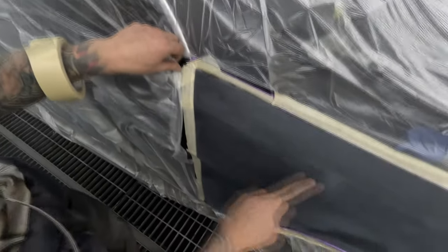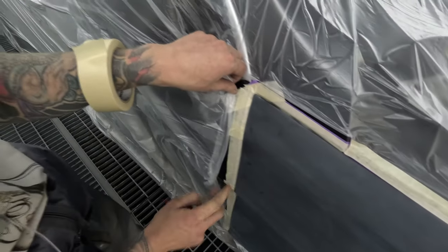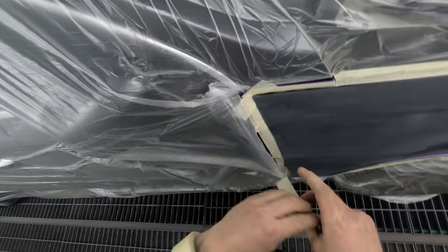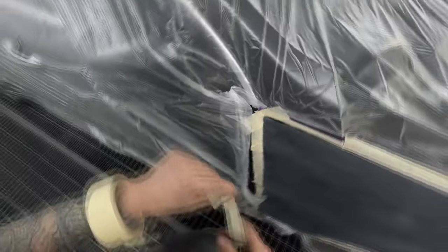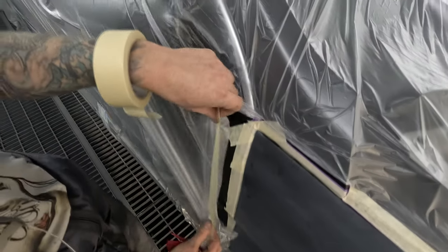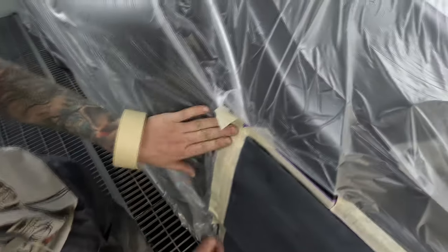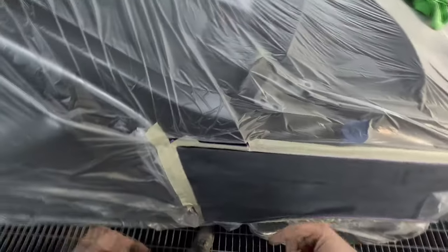I can tell just by looking at it, that's nice, fine prep work. So what I did is I started off by doing my normal prep. I went 800 grit on the orbital sander, then 1000 grit by hand with one of those grippy pads, and then I went over the top of it with one of them, but dry.